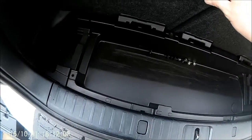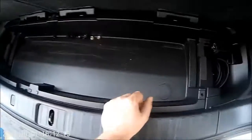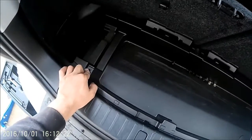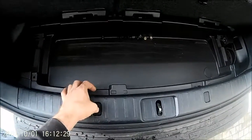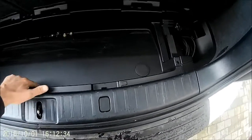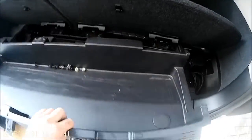That's where it stays because you've still got your front two bolts in this side, which is 12mm. Next, you have another two little poppers there and there - those need to be pulled out. Then you push your button in and your tray comes up slightly. It's quite hard with one hand, so do exactly the same on the other side - push it in - and then your whole front tray comes out.